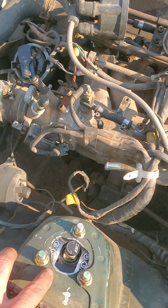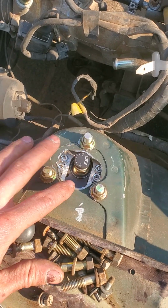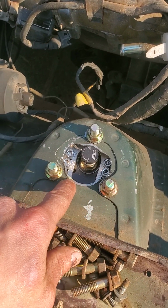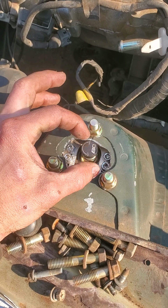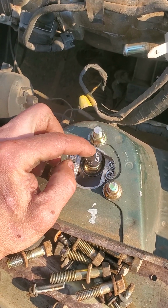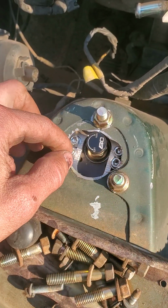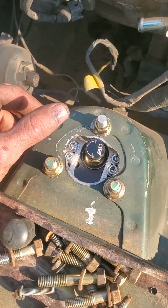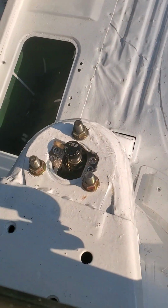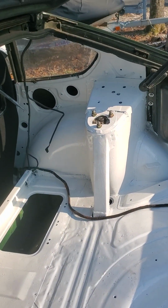You can see while mounting the coilovers here, I had to grind off some material. It's hard to tell anymore, but you can see the old silhouette. There used to be a little cup that would make this circle look tiny, and it wasn't enough to clear the knob for the coilover. I also had to widen this side to be able to reach those nuts in case they come loose, or if I need to adjust the suspension. Same thing on the back, exactly the same thing, had to be cut out and extended. Same thing on the other side.